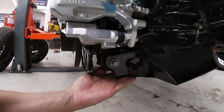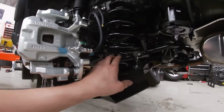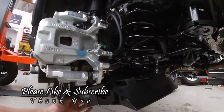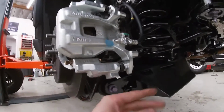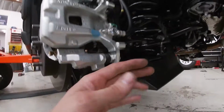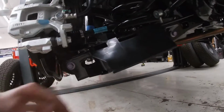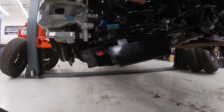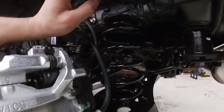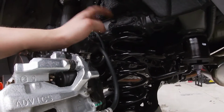Before undoing that, you have to have pressure against that, because this one is holding all of the pressure from the spring assembly. Even if you were able to take the nut off this side of the bolt, you wouldn't be able to get this bolt out of there with the spring pushing against it. But if you were, it would be horrible, because that arm would push down, spring would come out. Bad juju beans. Anyways, so we will put a jack under here, take this bolt out, slowly lower this arm down. That will relieve spring tension. Spring comes out, and then the new spacer goes in between the spring and the chassis.